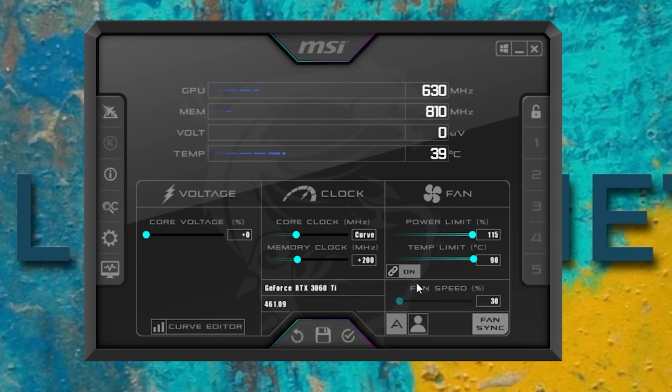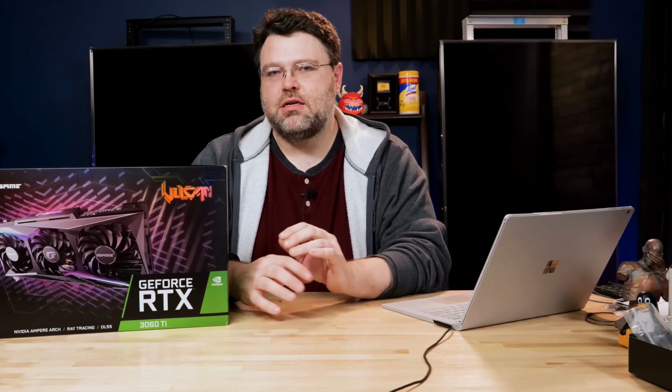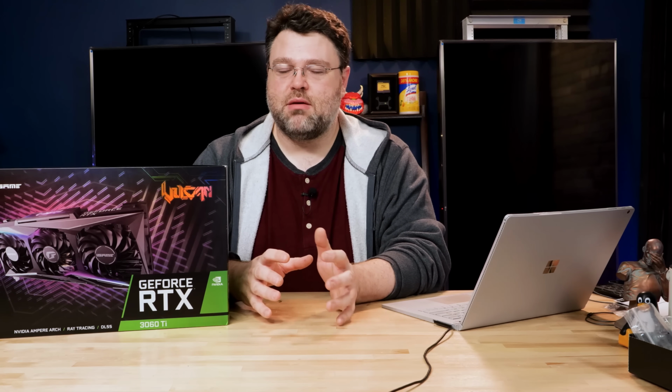Well, it depends on the OEM model. I'm sort of oversimplifying here, but I think it's fair to say that for some reason the silicon on this card didn't quite make the cut for a higher end card. Maybe it's to do with voltage, maybe it's to do with something else. Your best bet on overclocking this card is to start with the memory, but you can get some pretty decent core overclocks. It just depends on the game and stability and some other factors.